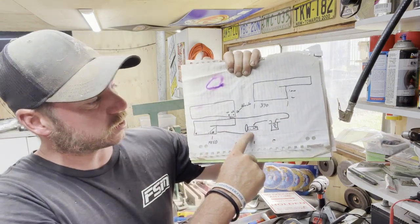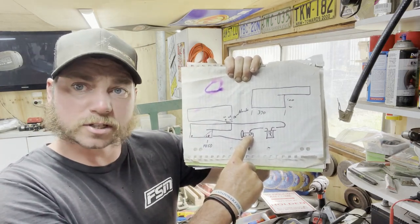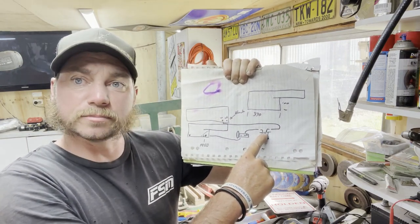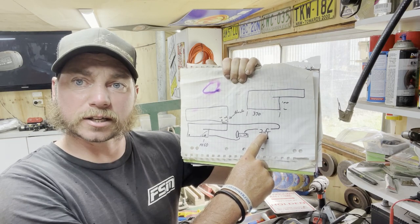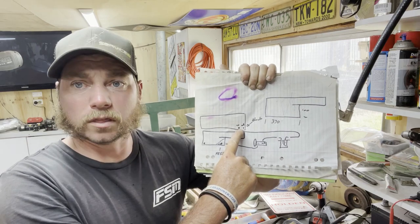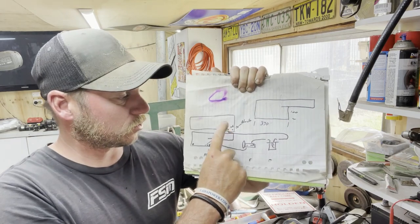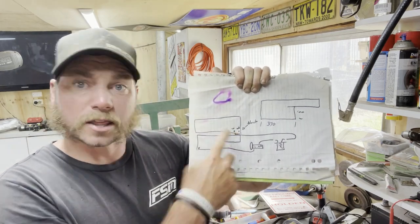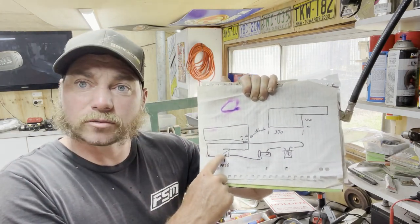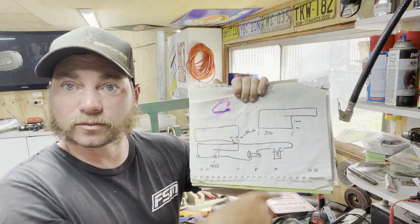From the pickup we'll be going to the inline pump, which will pressurise it and push it out into the oil filter. The oil filter will then filtrate the oil. Then it will come around into the inlet on the MerCruiser block - they already had separate oil filters and pumps anyway. Then it'll go all the way around the block doing its lubricating, come back down into the sump ready to be picked up again and back around. Vicious circle.